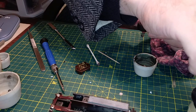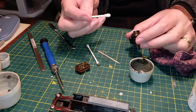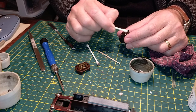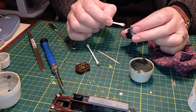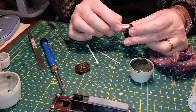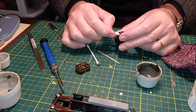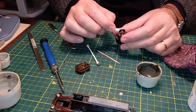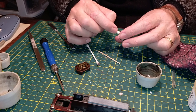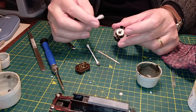There's some dirt that came out from the sections and the spaces. So we'll have to clean the commutator plates again to make sure there's no gunk that came out of those slots. That's quite nice - I'll polish it up another bit. Dab some more lighter fluid on this cotton bud. There's no more dirt coming off, which means it's nice and clean. So we'll clean the rotor axle as well - give that a clean. On a well-worn motor the brush dust goes everywhere.